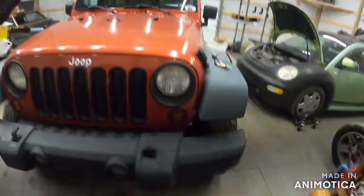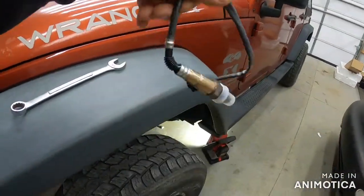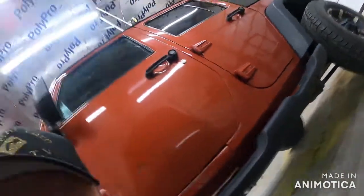But tonight we got the Commando. And we're going to do one last thing to make some more lights go off the dash: the old O2 sensor. The code says it's a downstream. Now, we're lucky. I believe we only have one downstream, so it shouldn't be too hard to find, being that this is a single pipe, dual outlet. So hopefully we can find this sucker with a little bit of ease.